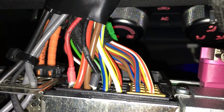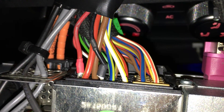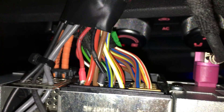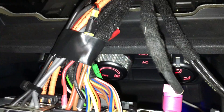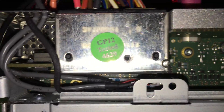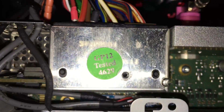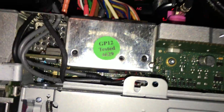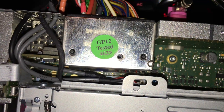To quickly explain how I did it: I took power — the 12-volt supply — from the main power cords. You should take a multimeter and check which one's which, just to make sure you're on the safe side and don't short circuit anything. I accidentally did create a short circuit at the Bluetooth receiver, however it didn't break. I'm assuming there's a diode not permitting the current to flow the other way, which is great. So this circuit board is very safe for DIY users who don't know exactly what they're doing and might make a mistake along the way.